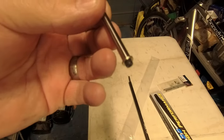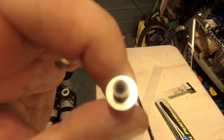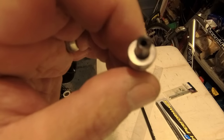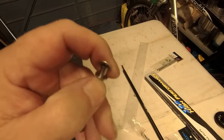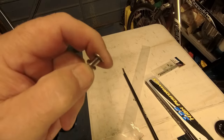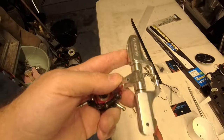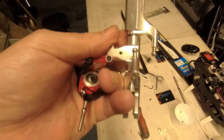I'm going to use the old shaft to press this one in. One thing I should have mentioned - your bearings do have an in and an out side, and they are marked up. This one is 'in' and on the other side it will be 'out'. Put them in the right way, and there you go - one rebuilt head, smooth as a baby's bottom. Perfect.